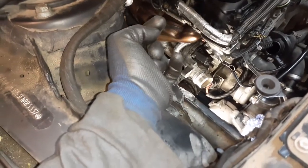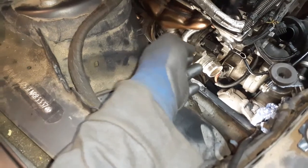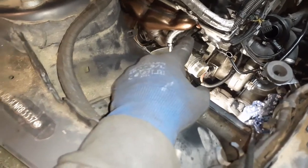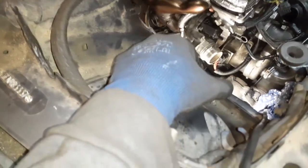Okay, so once you get the lines all connected from underneath, so the oil feed line to the bottom of the block and the return line to the bottom of the turbo, you have to fiddle with the gaskets and the little Torx bolts. You have to fiddle with the coolant lines. You have to push them on, use a pry bar to press on them so that you can get the Allen bolt in, and you torque them all down to the appropriate spec, which is 88 inch-pounds.